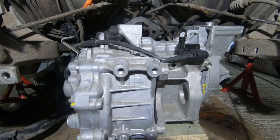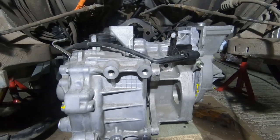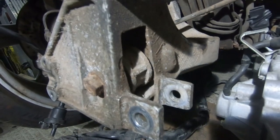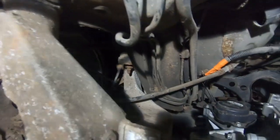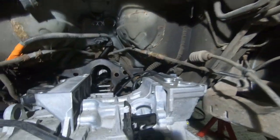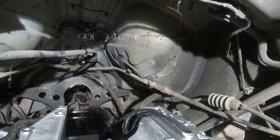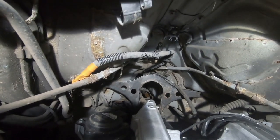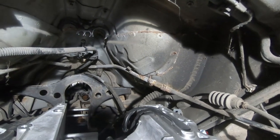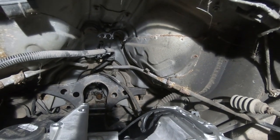Width-wise we're actually fine. In terms of structural components of the car — the suspension uprights and where they connect to on the body and on the chassis — they're all fine. The frame rails, it fits in between. The challenge comes when we start to look at the other parts of the body. What we've got here are the two indentations for the rear seats, and they really impinge on the space. The gearbox fit in here fine, and I'll show you the motor compared to the gearbox in detail in a moment.